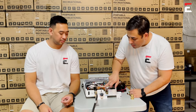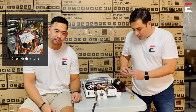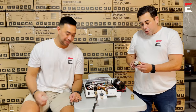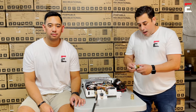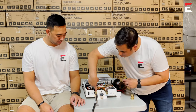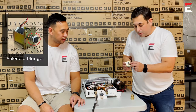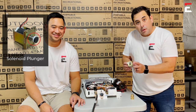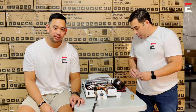The other thing you'll want to look at is the gas solenoid, right here. Two ways to make sure it's working: first, just tap on it to clear out anything that might be stuck in it. The other thing — if you're able to take it out using these two screws — you can look at the plunger, push down on it, and make sure the spring is actually pushing it back up. If that happens, the part is good.